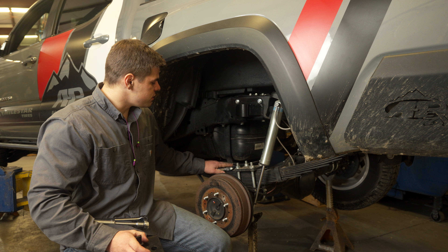Once your top bracket is tightened down and your bottom striking surface is torqued to spec, the final step is installing the actual bump stop. The specific heights, measurements, and application recommendations for your vehicle will be covered in another video — we'll link that in the description. For now, we'll get it mocked up so you can see what it looks like. Tighten down the rings to get them snug, throw the locking ring on, and use the included spanner wrench to cinch it into place so it's tight and ready to go.